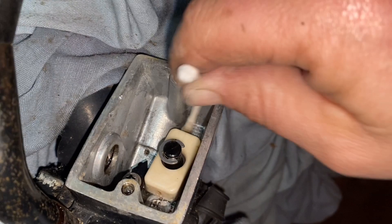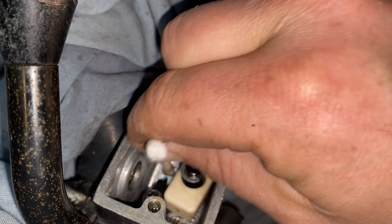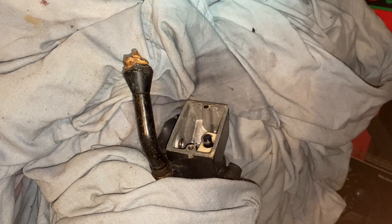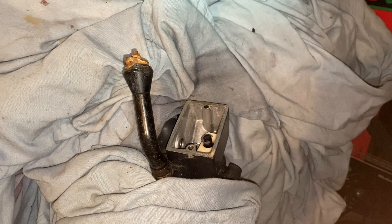But I've been surprised before. Let me get some of this junk out of here, get just a little bit extra dirt out of there. In the next video I think we're going to bleed out the brakes. We don't have to bleed them — I mean there's air in the system now. We're going to try and chase fluid down — that'll tell me if the master works. If we can pump pressure here and get it to come out the bottom, it'll work. Let's put new fluid in the system, and like I said we'll probably end up having to do a teardown on the calipers in the end, but hopefully we can get good fluid down through and that's a good start anyway.